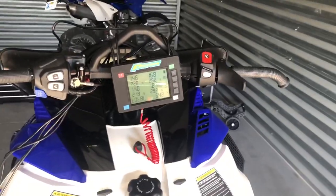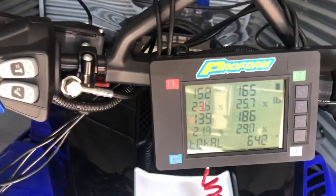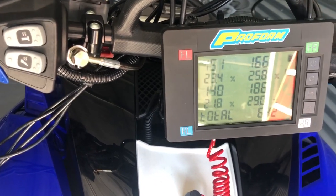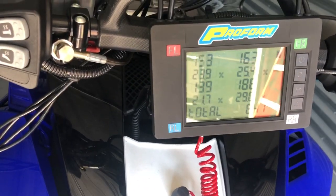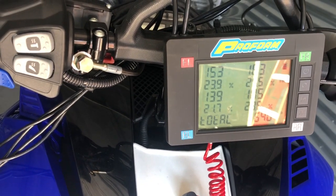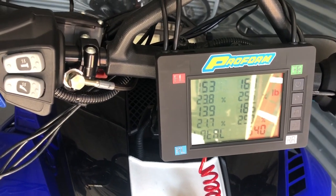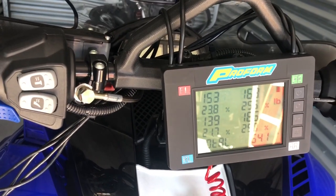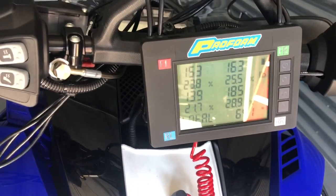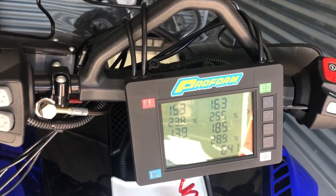Greetings. Yeah, so there's been some discussion about the setup of the MTX, BTX front end. So I have it on scales right now. This is already calibrated. So you'll notice that once I sit on the sled, the weight distribution is 43% in the front and 57 in the back. I imagine with gear on that might shift a bit, but as it stands right now, I'm approximately 195, 200 pound rider. And this is how the sled is set up.